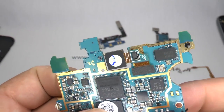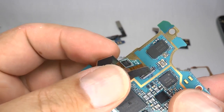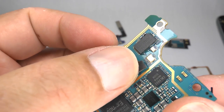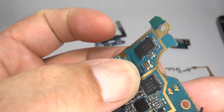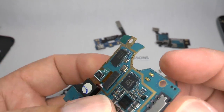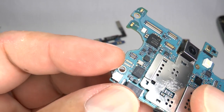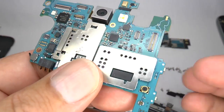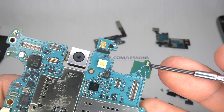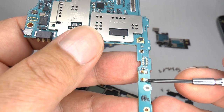If you need to replace the camera, just gently lift the rear connector up, then take your replacement camera and plug it back in again. This is the little S Pen switch that detects when you remove and put the S Pen into the phone. External 3G test port. Your 4G antenna connections are here. And this is for supporting a wireless charging battery cover.